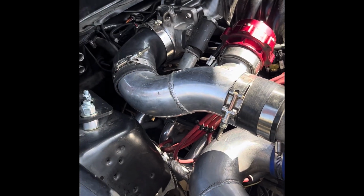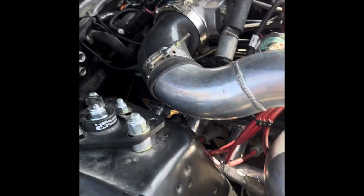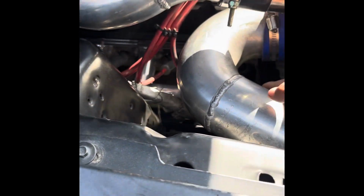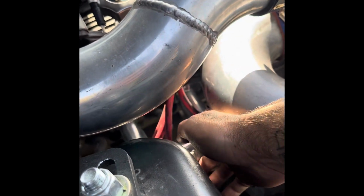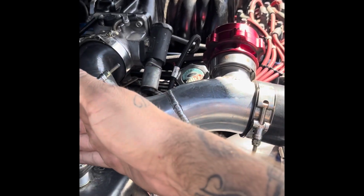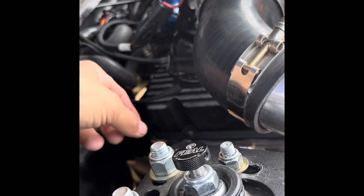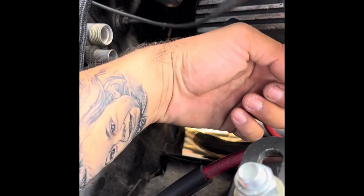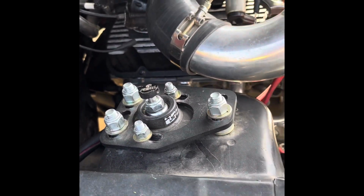The passenger side, let's see, you probably didn't need to take off the throttle body. I had to raise my motor. I probably had enough space to even just finesse it straight through here. So basically, I tied a knot in a rope right there in front of the header, just about where the spark plug wire is. Tied the rope there, raised the engine, finessed the header right in. Same thing, put the new gasket. I got 1 bolt tied in on each side, then the one at the very front. From there, I lowered the motor back onto its K-member bolts.